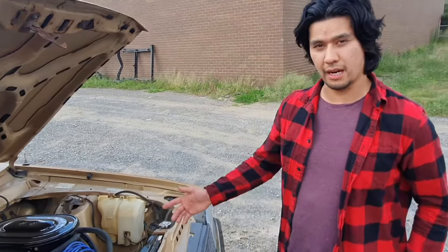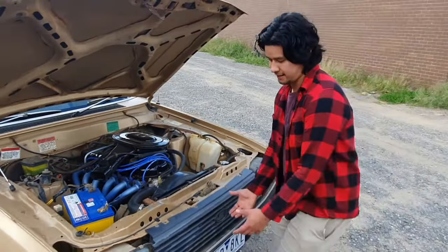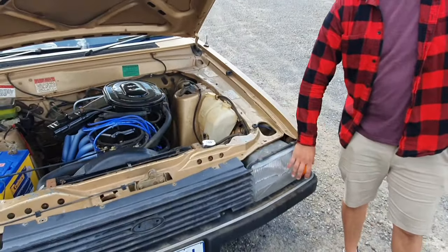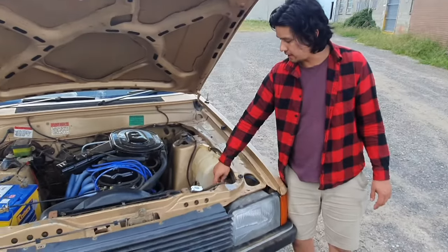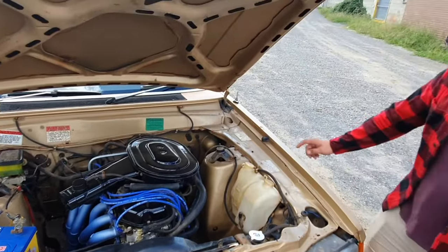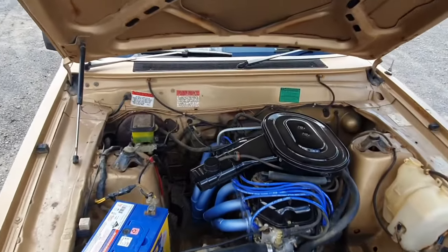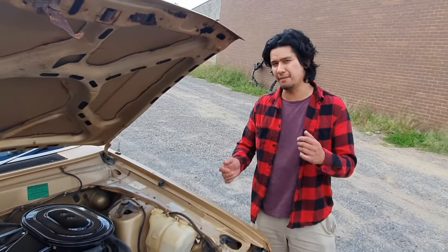I'll talk you through some of the work I did to make this car roadworthy. Starting from the easy stuff — I removed the driving lights here, I'm looking for a grill that doesn't have the driving lights as I think it looks nicer, and that's why I haven't put the Ford badge back on. I replaced this whole front headlight assembly because it was rusted on the inside — I tried to open it up and spray it but it was way too rusty. The horn wasn't working so I was cleaning all the connecting points. I've taken off the rocker cover and painted it black, as well as the air cleaner. It's got a new air filter — a Ryco air filter — and I put new leads, which was easy to do. One part that was a bit annoying was they needed a new EGR pipe. I went to NZ and got them to bend me off a new pipe, but the material they used was an industrial strength pipe — it was difficult to get on and hard to bend up, but I got it in place, all good.